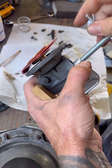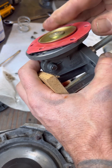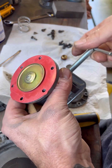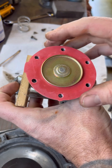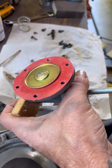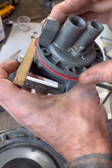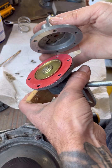You're supposed to put a preload on these pumps and I don't have the special tool, so this is how I did it — I just grabbed a C-clamp and a little block of wood. The point is to get that diaphragm to lay even and flat. You don't want to just sandwich it down with the spring and tighten the screws, because then you'll have wrinkles or waves in the diaphragm and failure later on.